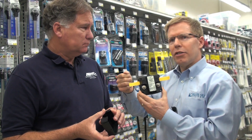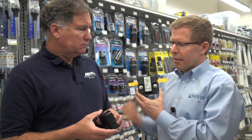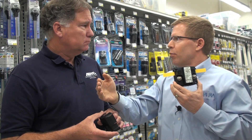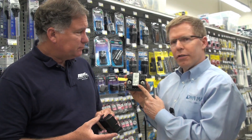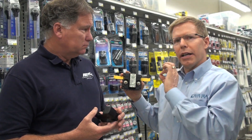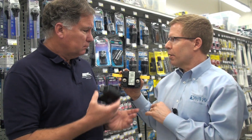So when you go to start the engine, there's a big voltage drop and then a spike, and that can cause your electronics to blink out. What this start isolation wire does is go up to the ignition, and it senses that there is a starting sequence going on, and it will separate the two batteries, protecting those electronics. The third terminal is for a remote LED. The product does have an LED right on it, but it's often mounted near the batteries in an inaccessible location, so this allows you to bring an LED up to the dash so you can monitor that it's working properly.